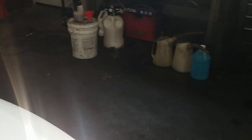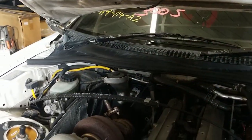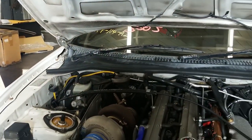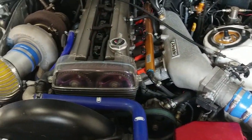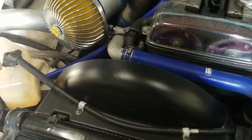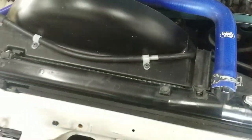So a little thing we found out when I checked the car out is that he has said that it's a 100 octane tune with 700 horsepower. Now, this should show you the difference in technology and how far technology has come. Okay, so this has, according to the owner, a 3.2 liter stroker kit, forged bottom end, forged crank, rods and pistons, has cams, I believe stage 2 cams, HKS, obviously pretty much belt, timing pulley and all that stuff, Kevlar serpentine belt, Samco hoses.